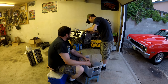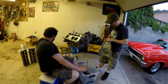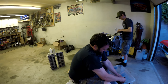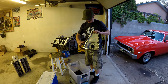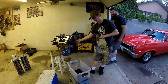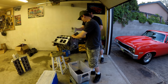Starting to button this up — he greased the seal or oiled it. He was talking about putting oil on the one side that has friction on it. You could put a little bit of oil on the balancer when you put it on. I put just a little bit of oil on this seal — it's like an oil filter, you want it to seal against the surface. We're using this crank pulley installer tool that Rob made — just an old stock crank pulley with the actual pulley cut off — pop it right in here for the alignment process.